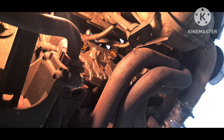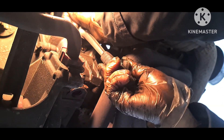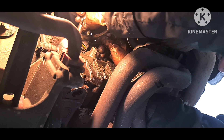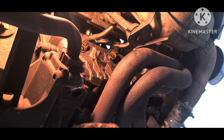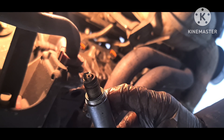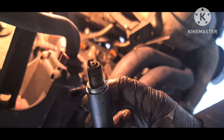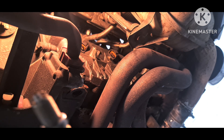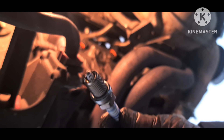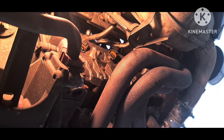The first one is easy to remove. The spark plug has a good color, so I'm pretty sure the misfire fault code is about the coil pack, not the plug itself. This is the new one — I'm using a four-pole spark plug, so it's easy to fit it back in.